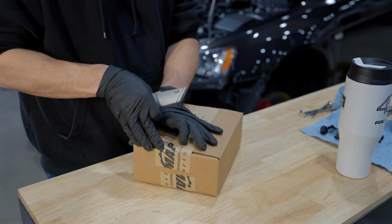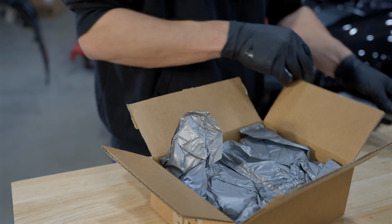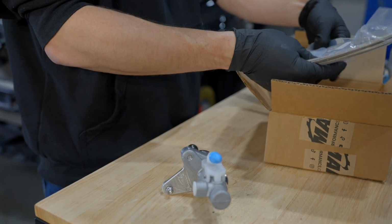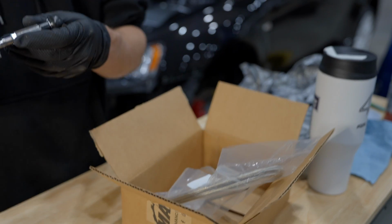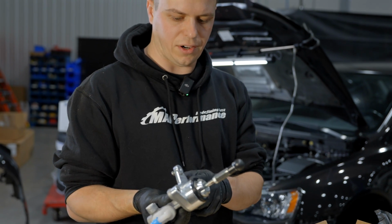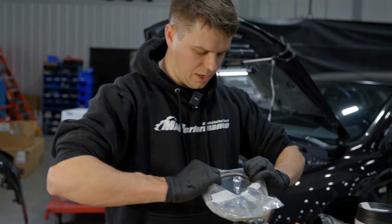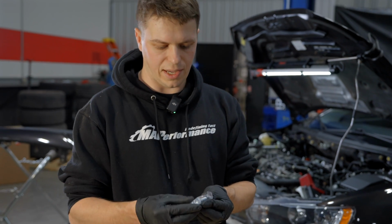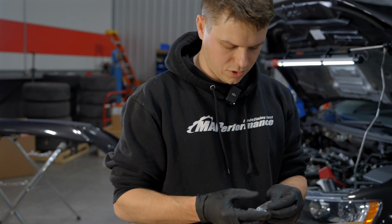This will be our clutch master replacement. Not made of plastic. What do y'all get in the kit besides the thing itself? So, we're getting an OEM Evo 8/9 clutch master with our bracket that adapts it to the Evo 9 or Evo X firewall and clutch pedal, and then also a replacement stainless line to go from the master to the slave. So we're going to remove the factory line out of the car as well while we're at it. So yeah. Sweet. Sounds pretty good.